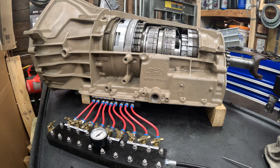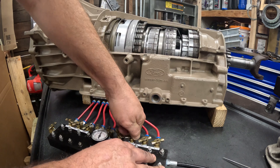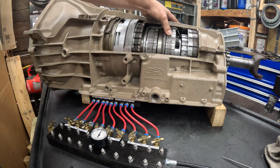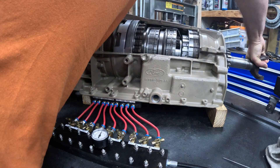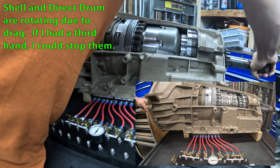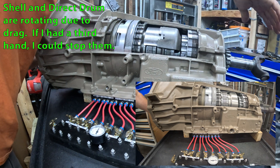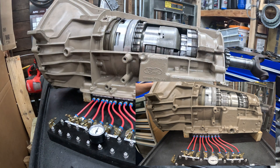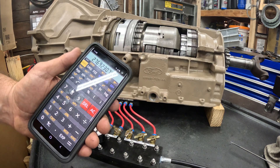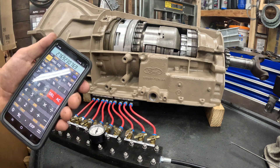Let's fire this up — we're going to go one full rotation on the input shaft and you should see the forward pack get engaged. There it goes — forward pack is locked. Let's count up the teeth. Looks like about six and a half — I got 2.77 on my output ratio. Our expected was 2.71. That's probably because I'm using eyeballs and maybe I didn't provide enough load on it, but as you can see we're pretty close.